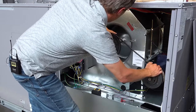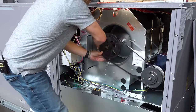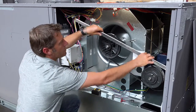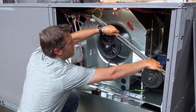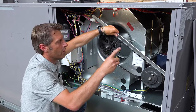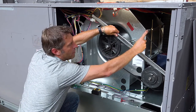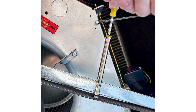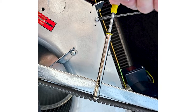Put the belt on — watch your fingers. Now we've got our straight edge. We're going to put the straight edge along the belt to check our deflection force. We already have the belt tensioner preset to where we need it to be. Put it on the belt — our pounds of force lines up perfectly with our deflection span.